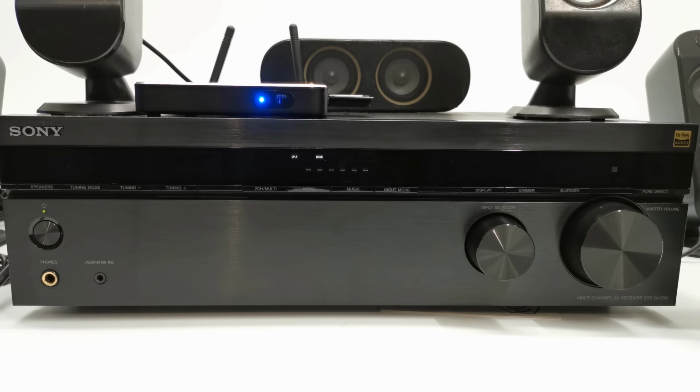As mentioned earlier in the system and hardware information, I was a bit concerned that I couldn't identify any surround sound audio decoders. So to test whether it has decoders or not, as usual, I will connect it to my 7.1 audio receiver and play my list of videos encoded with surround sound formats such as Dolby Atmos, DTS:X, DTS-HD Master Audio, Dolby Surround and Dolby TrueHD.